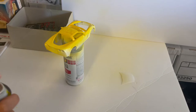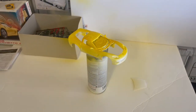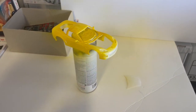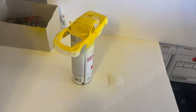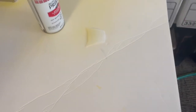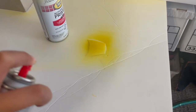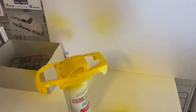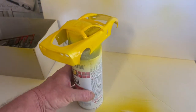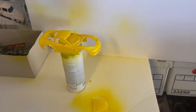Try to aim for the car and not everything else. That's good — just a dusting is all we need for now, just for it to tack up. Kind of aim for the bottom, not the top, and just another light coat. There you go, you're getting it. Now we're going to rotate it again and catch the front — just a light coat. Let's go ahead and throw a light coat on the hood too. Now another thin coat there, just a real thin coat.